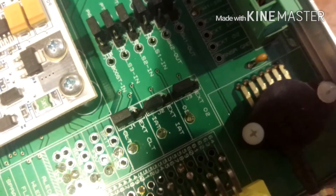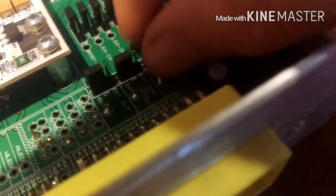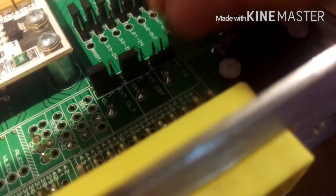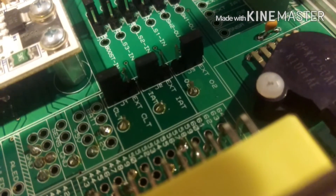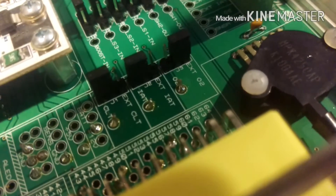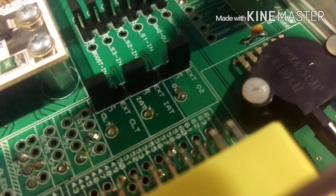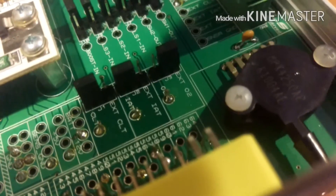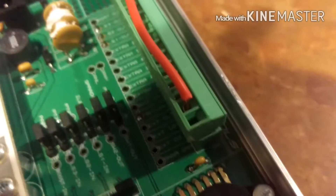The next step is to find the J3 pin — it's in that position there. We're going to move it: just pull it out and swap it over. What that basically does is change it from having the Mega Squirt — the plug-and-play Mega Squirt — reading the stock O2 sensors, and changes it so that it is now reading the wideband that you just wired in.